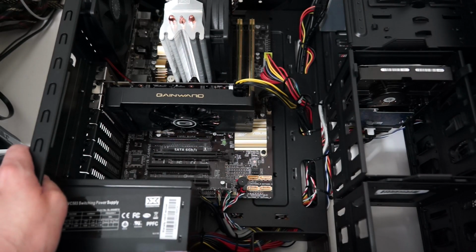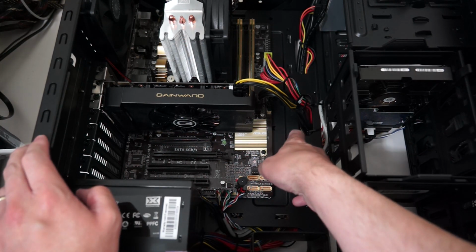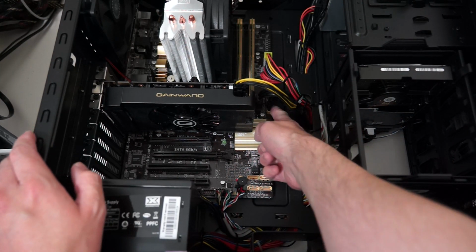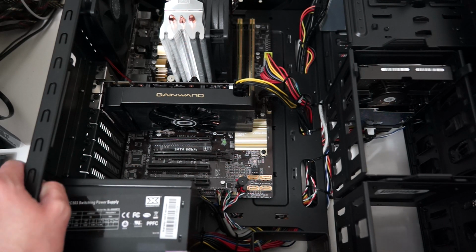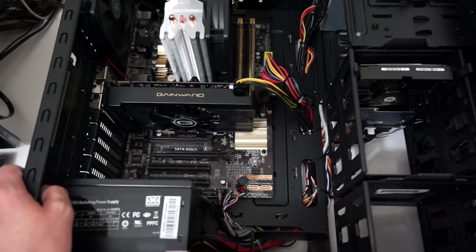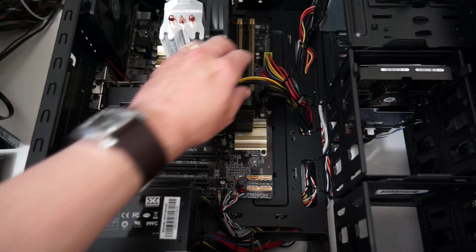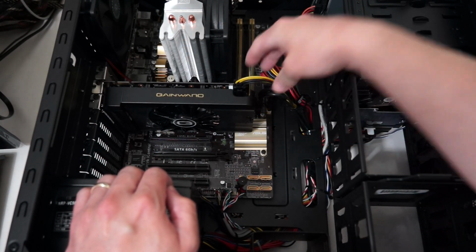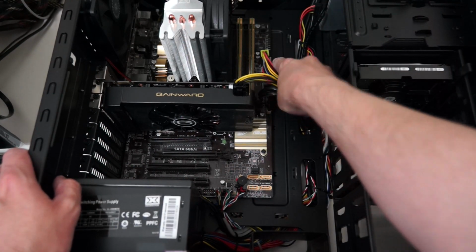They've also decided to use a similar colour for the SATA 3 data connectors. There are, interestingly enough, two further ones up here, so 4 down here, 2 up at mid-board, and that's quite an interesting, unique way to do that. Not seen that often before, usually about as far up as here at the very most, but Asus have decided to put some up mid-board, which is great, because what that means is we have the power coming out of the graphics card, that's a 6-pin connector, the USB 3 front panel wiring, the SATA wire, and the 24-pin power connector all coming out in one bunch, which are tied together.